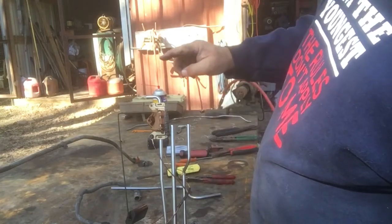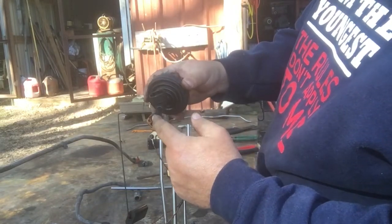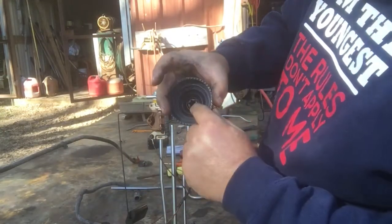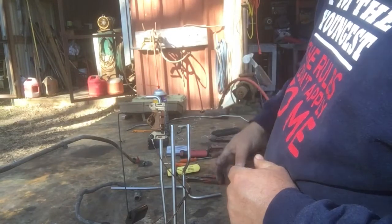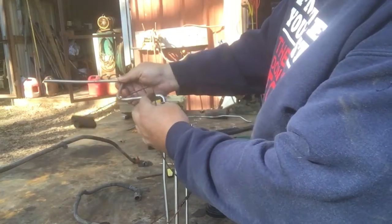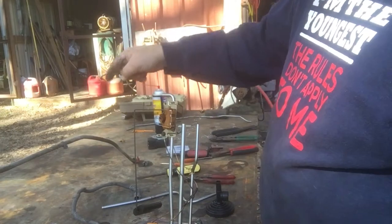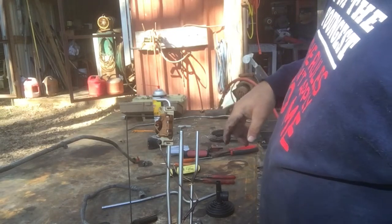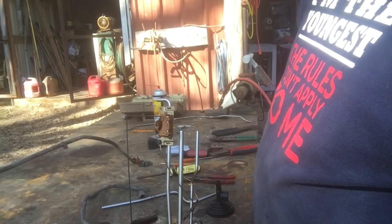Basically we're going to extend this and put it back on. I'm going to drill through here with a 3/8 bit, just clamped in a vise and screwed by hand. Then we'll run the tube all the way through, just barely through here, and put a union on it. We've got this one bent with a Z right there - we're going to put a union here and the Z keeps it away from the float. We've got a spare piece of stainless 3/8 which we'll cut our straight extension with, and I need to go find a 5/16 union.